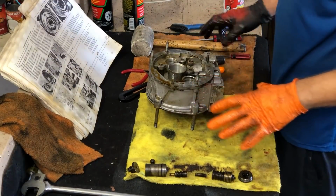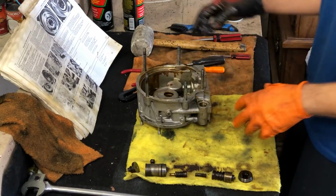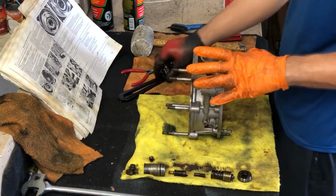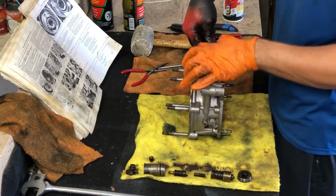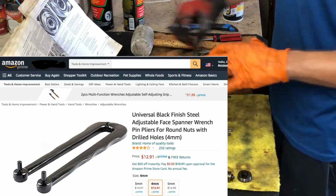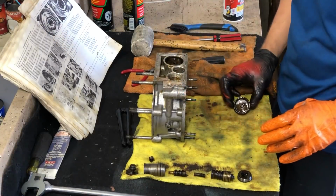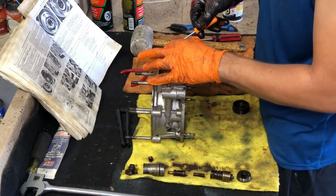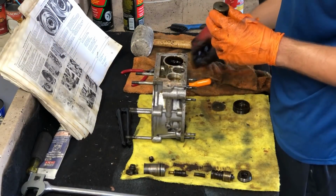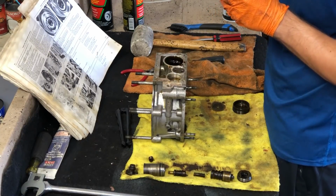Let's move on to the second valve, the pump valve. No, the filter. The biggest of the three, the largest of the three, is the filter. And I expect this to be right dirty in keeping with the rest of the trans. This tool's called a pin wrench, and I think these are 4 millimeters. Probably should have gone to 4.5 if they had such a thing. Right, let's see the grossness. Gentle extraction, don't poke through your filter. Is there an upside down side? Let's see. No, I don't see anything marking up or down, so I'll just put a U for up.